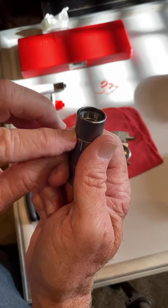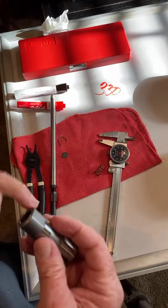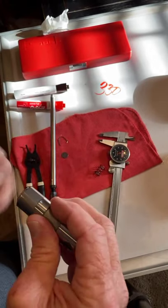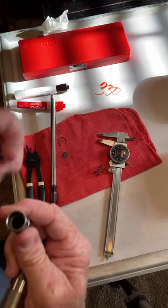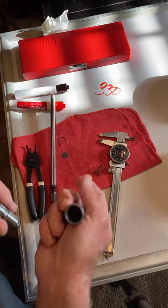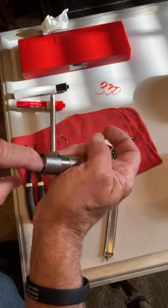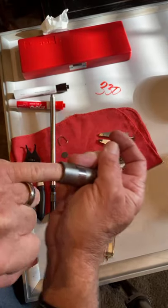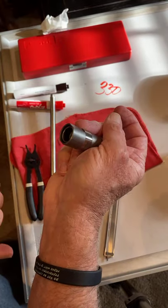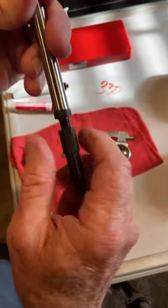They might have one that has a 100 thou spacer that goes under the piston, and won't let this go down that far. Maybe they'll only go down 100. Instead of going down 200 like this, it'll go down, say, 100. And you need to adjust this accordingly, not by somebody's amount of turns.